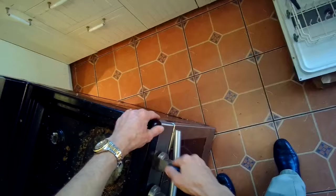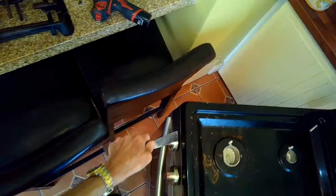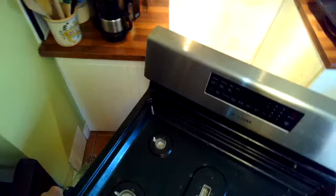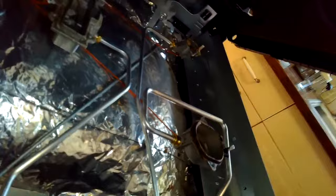I'm going to push in on those clips to get this drip pan off. I'll grab the paint scraper — you'll be able to feel where that clip is, then just push in and lift up on the drip pan, and then do it on the other side too. There we go — lift that off, and you're going to see a lot of the stove components are now available to us. Pretty easy to get to.